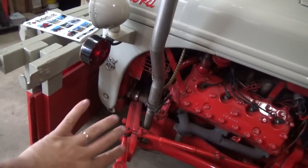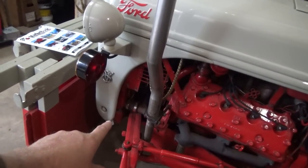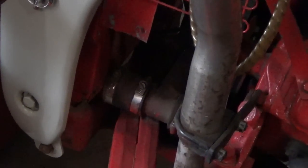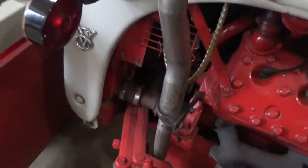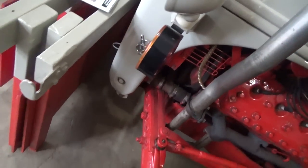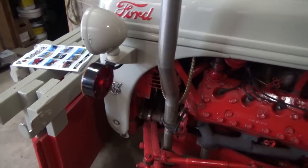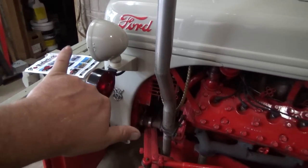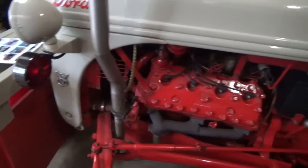This axle wouldn't flex enough, because he's got a big limiter on it, so it doesn't tear off these tubes and pipes here from the engine. It comes right out of the engine at the front there, and you have to run it straight through to the radiator. So if you put too much axle flexing in on the front axle bar here, you'll end up tearing that off, and then you're into a lot of trouble.